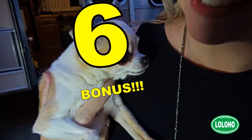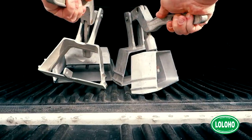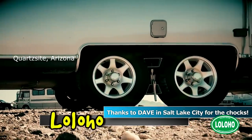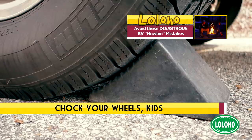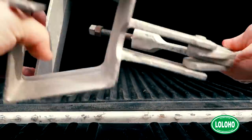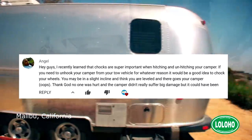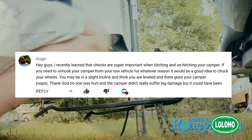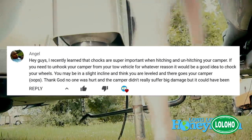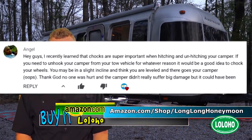The number six — wait, I said five. I'm giving you a bonus RV newbie mistake to avoid, and that involves wheel chocks. You need to make certain that you chock the wheels of any towable RV before you unhitch it. Once you get the RV in the proper position, chock those wheels, then remove it from the hitch ball. There have been situations where trailers that were not chocked have rolled once unhitched — not only can it devastate your RV, people could get injured or killed. Wheel chocks are a very important accessory that everybody needs to carry, especially if you have a towable RV. There will be links to wheel chocks in the description below.